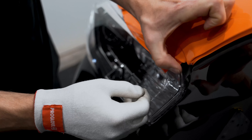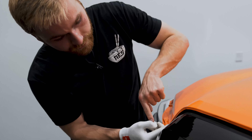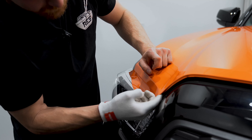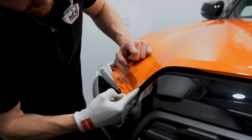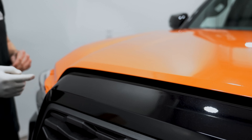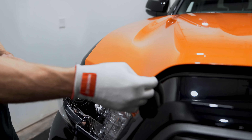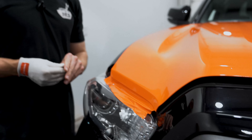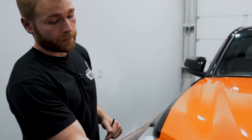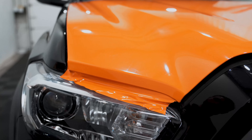Now I can roll around that corner and work this tension out this way. I can go through and roll this edge all the way around. At the end of this I will pick up the hood to ensure we have gone all the way around the edge and all of our edges are completely laid down — because if any edges have not been laid down, they will collect dirt, moisture, and that can cause premature failure of the vinyl.